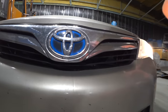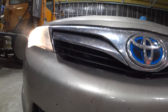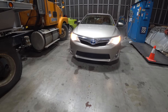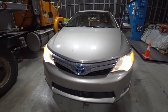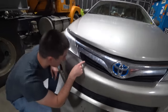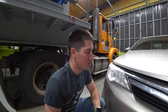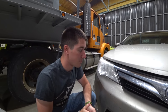There's literally coolant spraying out of the front of this. Let me put it in drive and see if it'll start spraying. So we're going to get under the hood and figure out what's going on. I have a pretty good idea — you can kind of see where this is spraying from. There's a secondary radiator right in here for the hybrid cooling system, and the coolant is spraying out of that radiator. There's like a rock hole in it. We're going to get that secondary radiator out that cools the battery and swap it out for a brand new one from Rock Auto.